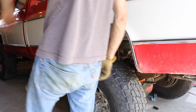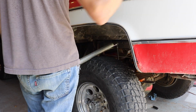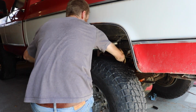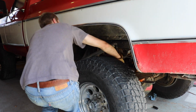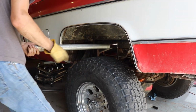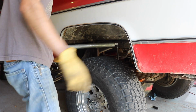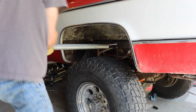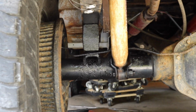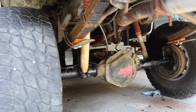I'm normally not filming because I'm just trying to get stuff done, but this will show you how tight these U-bolts are. And if you watch an old video, it's only like 4 years ago that I put these on. These things are so corroded already. Check this out. I don't have acetylene, but I already broke it free. PB Blaster. Heated it with a MAP gas, which does something, but not everything. And finally got all of the U-bolts off, and I wire brushed it, threw some satin Rust-Oleum on there. Just while I have the U-bolts off, might as well at least spray it with something.